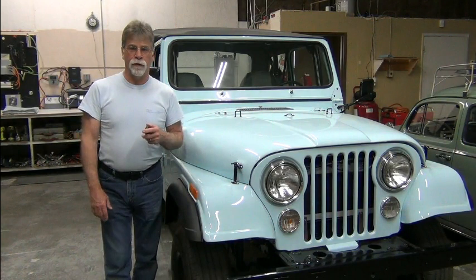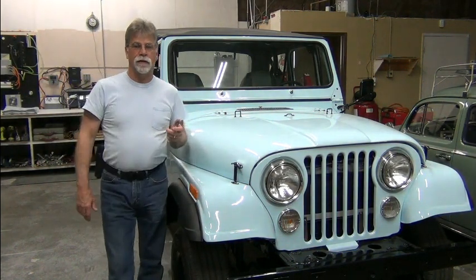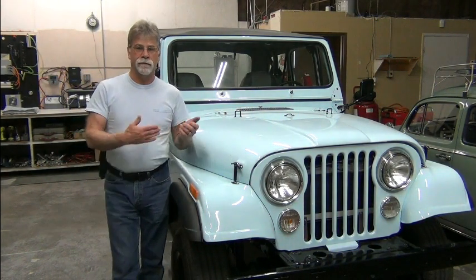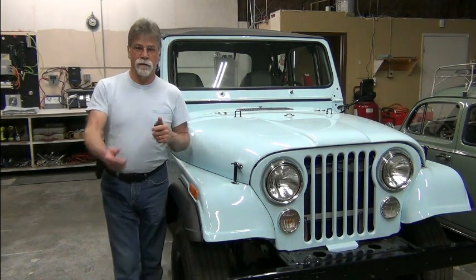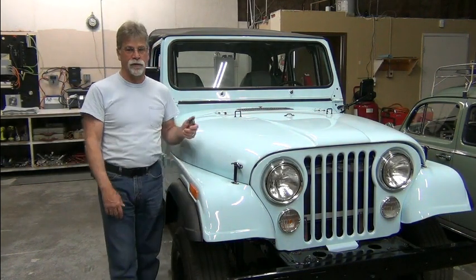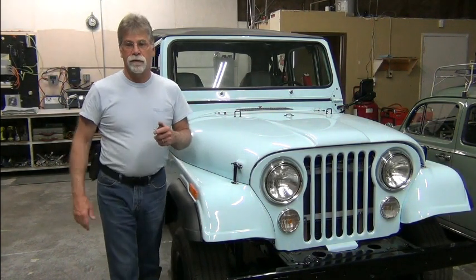And so we came up with a little circuit that allows us to circumvent the pre-charge driver and yet still pre-charge the caps and drive this thing. And that was in a previous episode. I'm not going to explain all that. But anyway, we came up with a simple little circuit to allow that to happen. So now the controller works.